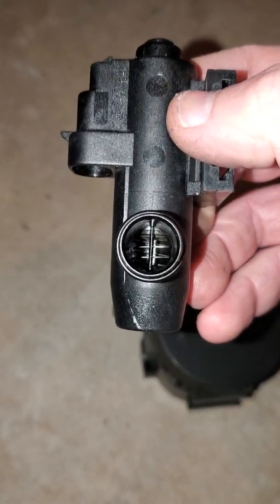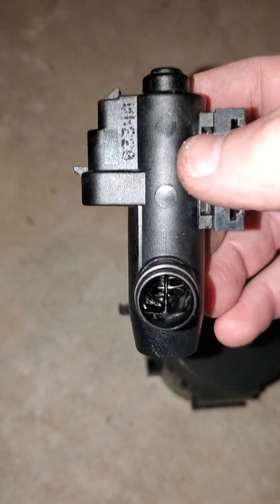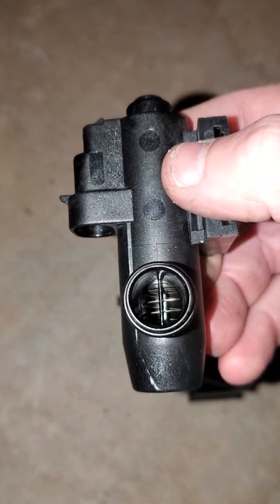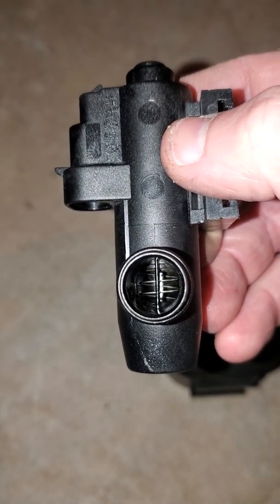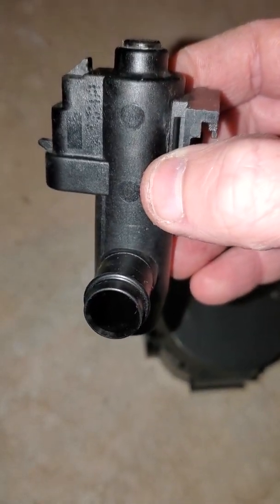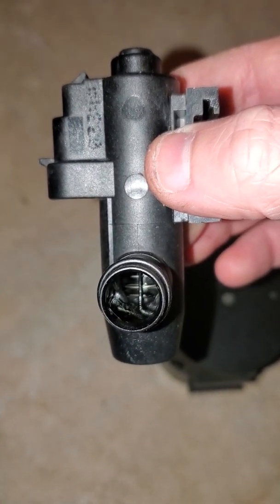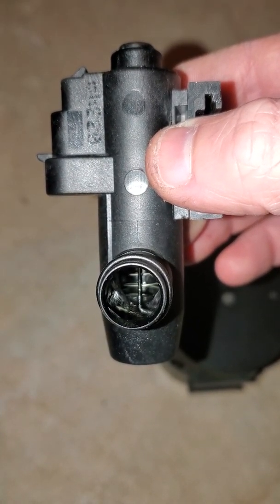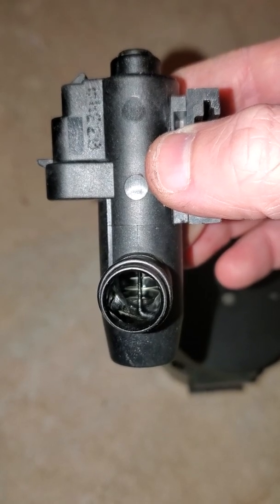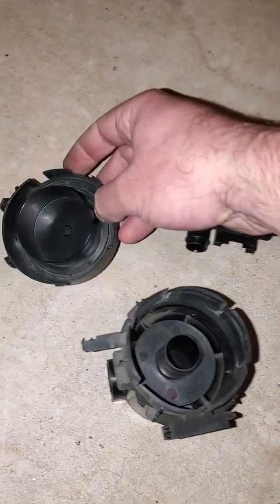Air comes through from a hose, so basically this is always open until the system wants to close it, and it only closes under certain circumstances. From what I read, coolant temperature has to be a certain degrees and ambient air temperature has to be a certain degrees — that's when it does its test. The way it works is this is always open, and then when it closes, the front purge solenoid will open and start sucking, allowing it to suck all the fumes out of the gas tank so they can be burned in the engine.